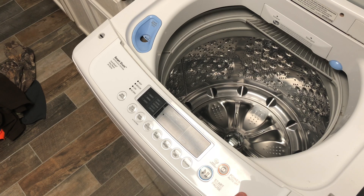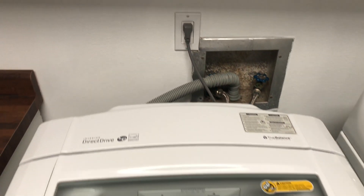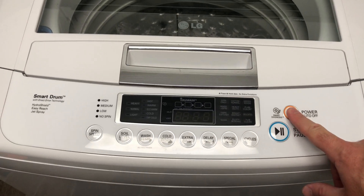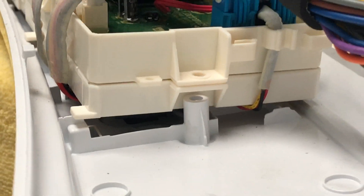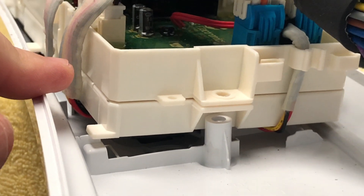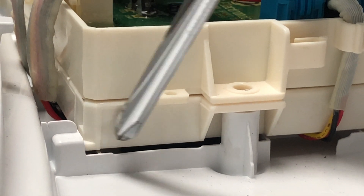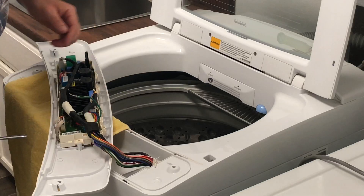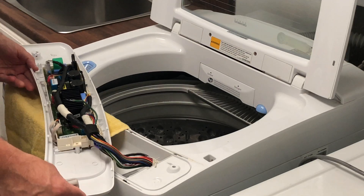We're going to hold off on the screws just a second to make sure we've done everything correctly. It looks like we've done something wrong. I see — I had not seated this down in there, so the button was not making contact. That's an easy fix — I'll just reset this. You should be able to test it by feeling the button on the bottom side; it should have some resistance. That's very important: you need to make sure the lip of this is underneath, or this thing's not going to work. Also, I noticed — I had to go back and watch the footage — there is one empty connector that nothing connects to, so be aware of that.